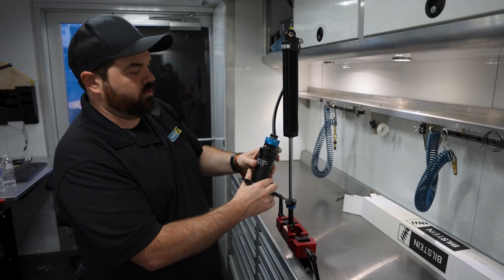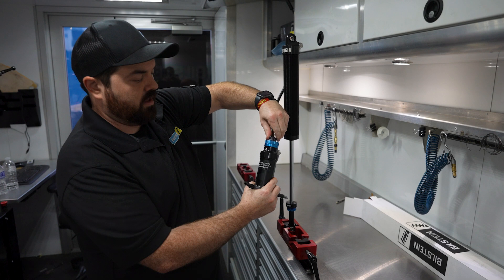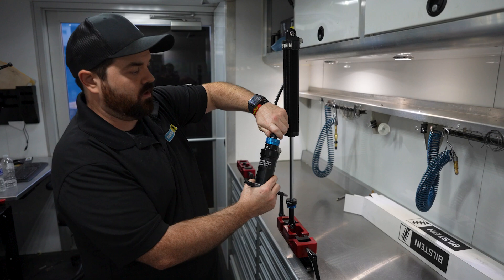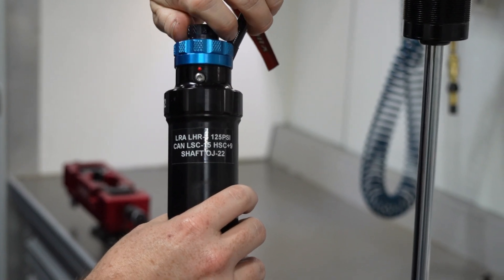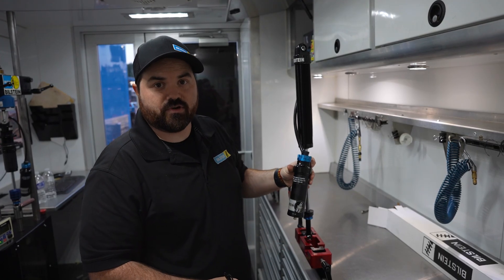For your low speed, you're always going to close it first, and then count back until open, which on here will be 15 — count back 15 counterclockwise. And that's how you set the specs on our shocks.